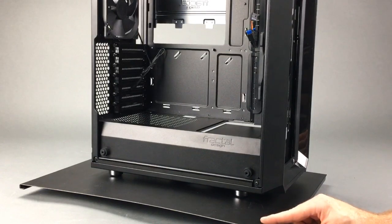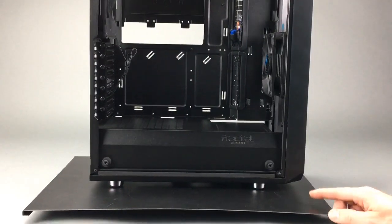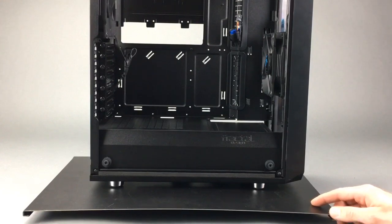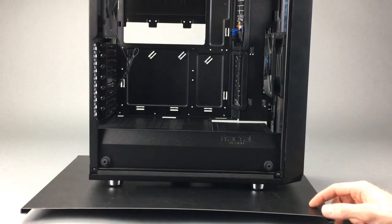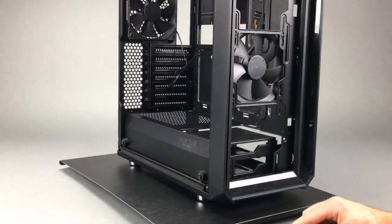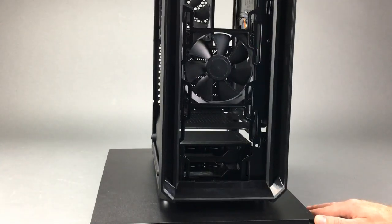And the big thing with hard drives is always the noise from them. But like anything today, have they refined them to be more quiet? Yeah, like the Western Digital green and blue series for the most part is virtually silent. Most of them are running at 5,400 RPMs now instead of 7,200 RPMs, so the power consumption is lower on them, but still it's just access time. Yeah, exactly.